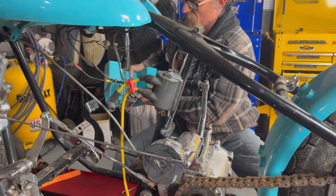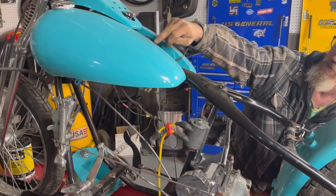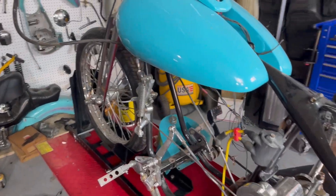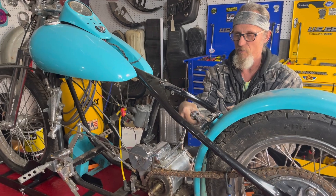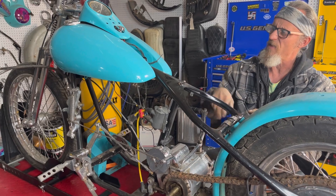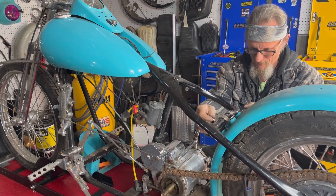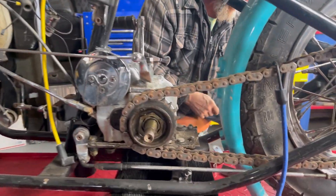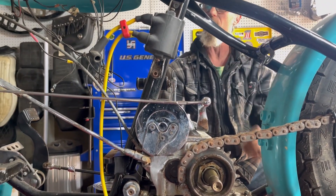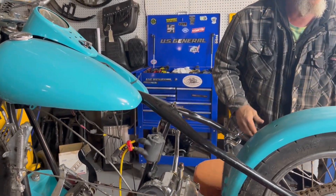Oil bag is out. I'm not too concerned about dinging these up - they've never been run, still have the masking tape on all the fittings. It's all going to get sandblasted down and redone. In fact I might just put a newer set of three-and-a-half tanks on there. These have one of those liner products in there and it wasn't really well done. I'm personally not a fan of that liner stuff anyway. I've always been told - and I'm of the school - if you keep your gas tanks full in the winter they don't have any reason to rust.